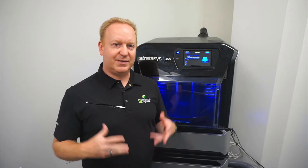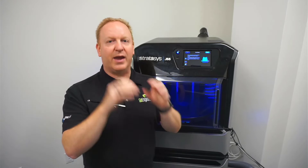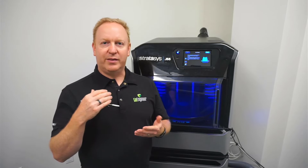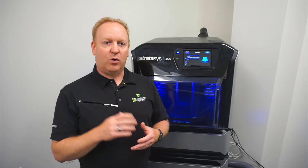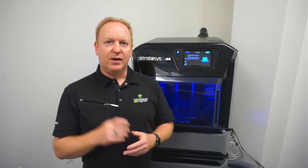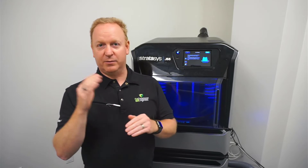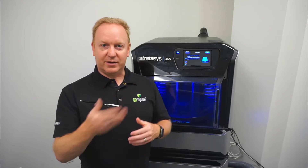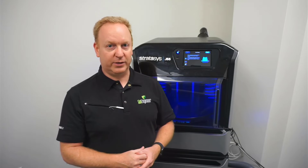What we do with this is it does a high pressure spray out of all the nozzles and the printheads. I use this when the printer has been sitting idle for several days, or if my print quality isn't quite what I'd want it to be. Then I can give it a good spray, a good cleaning. Sometimes I'll even purge and clean three or four times in a row to clean up those printheads and allow it to do the clean printing that it really should.